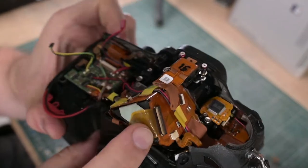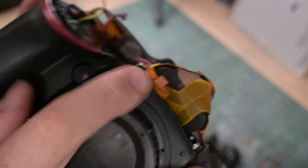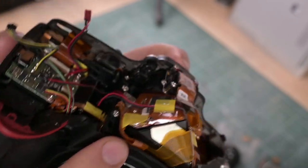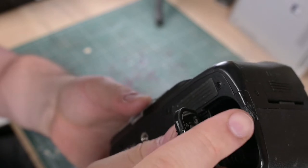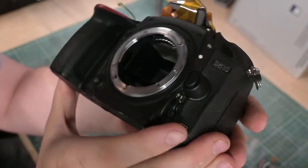This is the flex cable for the auto focusing screen that seems to be damaged. Also the aperture sensor flex cable seems to be broken, so I'll be replacing that one as a first priority as well. The only other real evidence of fall damage is on the bottom of the camera where it has a dent in the bottom panel which somewhat hinders the closure of the battery compartment cover, but it's mostly cosmetic — it still closes and the battery still stays in.